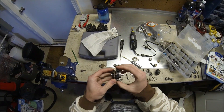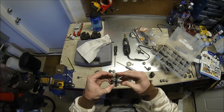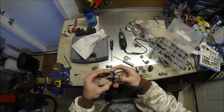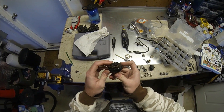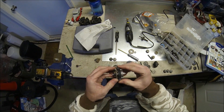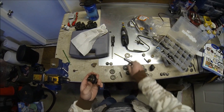This is with the Octane gear installed — that's 5 shims. It sits where it needs to sit, so that's 5 shims. But it's rough, so I need to take a shim out.